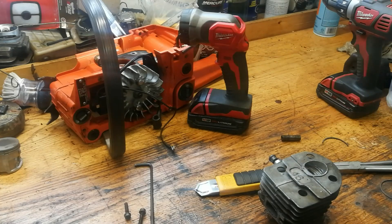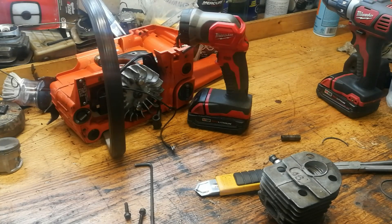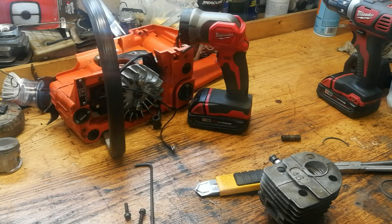Even if it has good compression it may look like this inside. Not long ago I took apart an 026 - the crankcase is actually still on the bench, unfortunately I lost the rest of the saw in a shop fire, but that's a whole different story. It still had 150 pounds of compression, but the intake skirt on the piston was razor sharp thin and the piston was actually rocking at top dead center and touching the cylinder because it was so worn out. There's a lot of stuff that can hide in a good running saw. So always pull your muffler - unless, like me, you're picking up saws for 5 or 10 bucks. Then it is what it is.